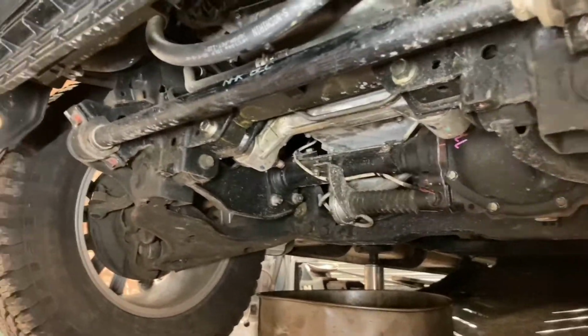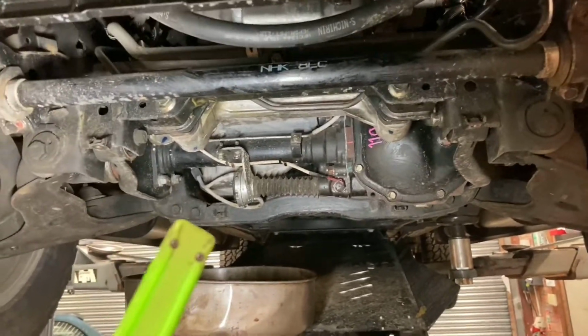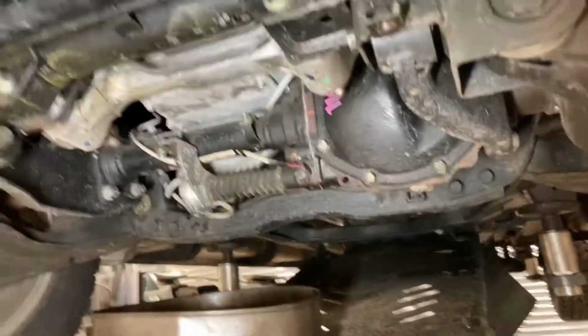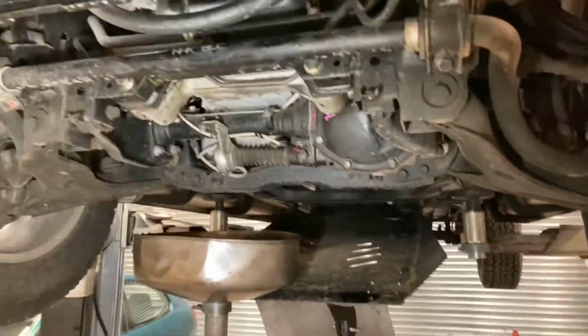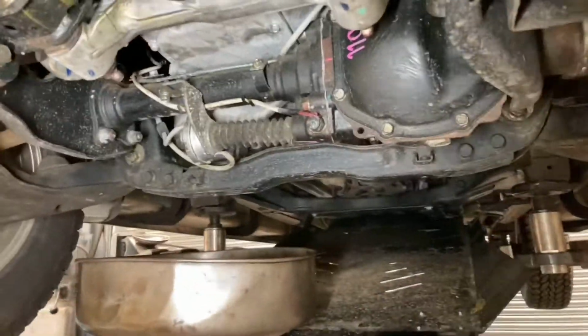Remember, once you've drained the oil and you've put your sump plug back on with the new seal to the correct torque, you don't just go too tight with them. Put your oil in, run the engine, then check underneath for leaks. Don't go straight away, like I see some people, banging all the covers back on underneath, starting the car up, because then that way you can't check for any leaks. So leave the covers off till you've had the engine running.